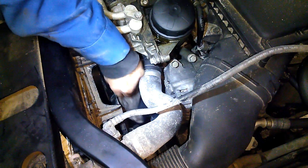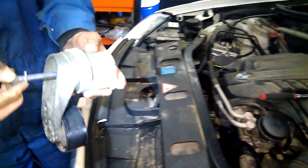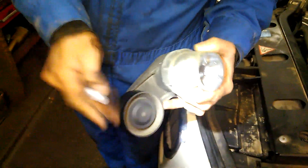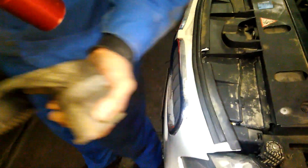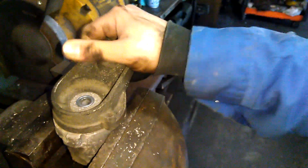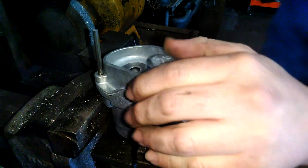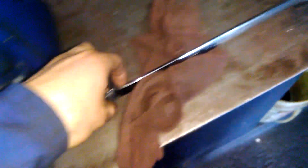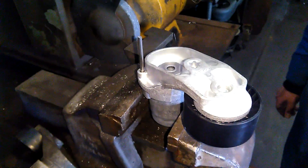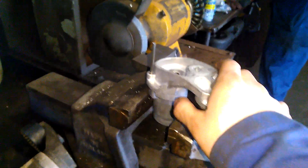This is how easy it is to remove. There are two bolts — or one bolt and a tensioner thing. That's what it looks like. Put it in the vise and see how tight it is? See, this is the old one — you could just move that by hand. That's loose. So now we can't really move it, but we also have the pin in it. You need to move it to get the pin out. That's why we have tools to do that once it's installed, because that's tight. The new one's going to be tight too — you're not going to move it by hand. That's why we have tools.